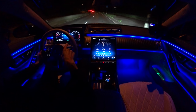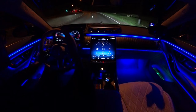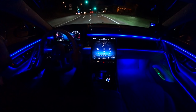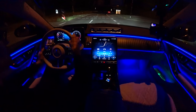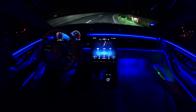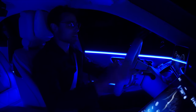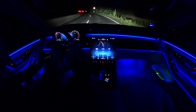So when I'm on the brakes, this EQ charge meter goes up, and so I can regenerate some of the power back again. This helps the fuel economy, and you can drive this car actually very efficiently. My best result for long-term motorway driving is indeed some 9 liters per 100 kilometers, which is then some 30 mpg. That's excellent for this kind of engine, for this kind of size. Of course, if you have more city traffic, then it's more.